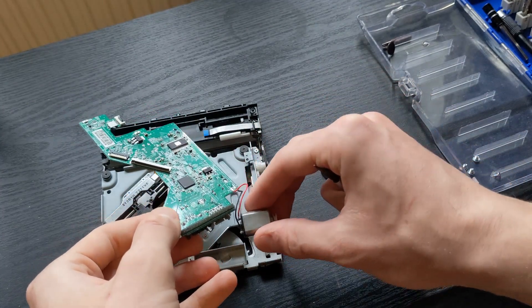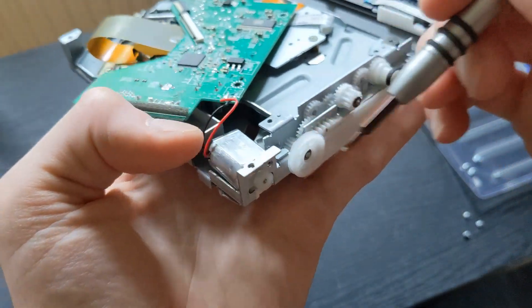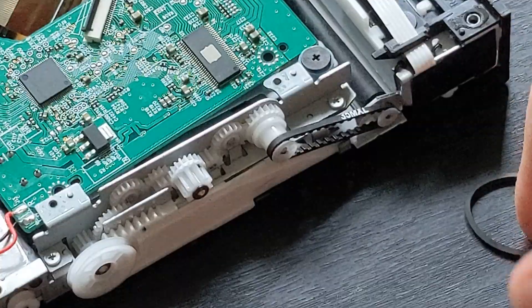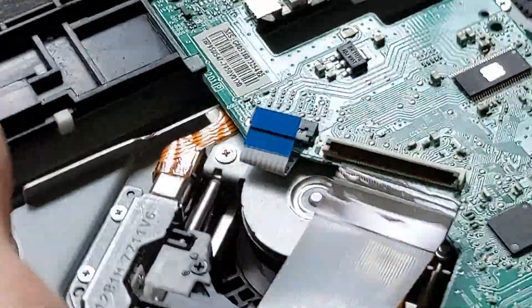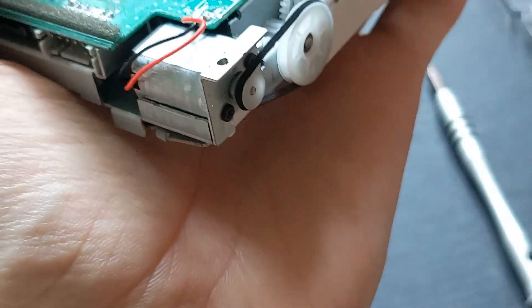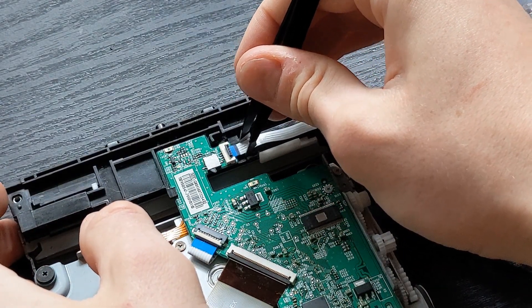Here we've got our original logic board — the one that's hard-coded to our Xbox. Begin by putting the motor in its slot. There's quite a big gap down here, so get this bit of plastic under there and pull it up so it slots into place. Make sure the numbering is on top, then screw it into place with the black screws. Next, put the logic board in — remember there's a plastic notch up here, so stick it in, let it drop, and grab the three silver screws: one up here, one here, and one in this little corner. Then grab the fan belt and hook it over.